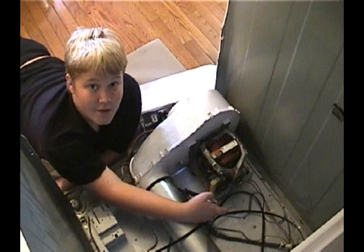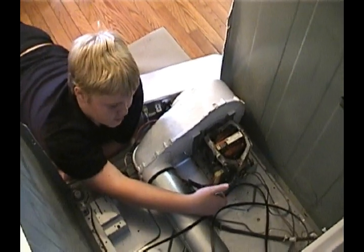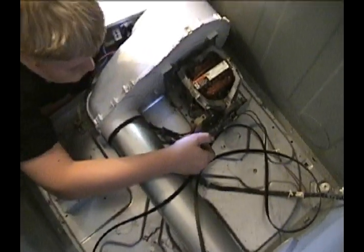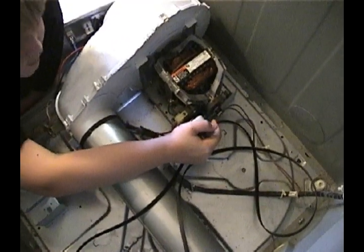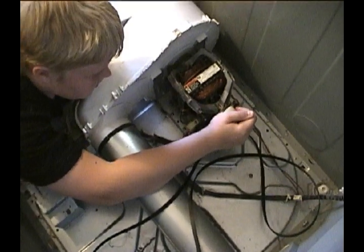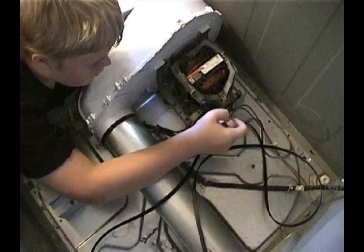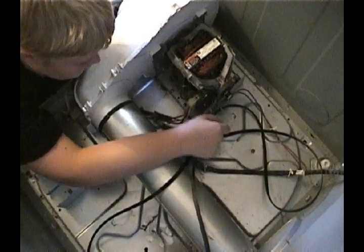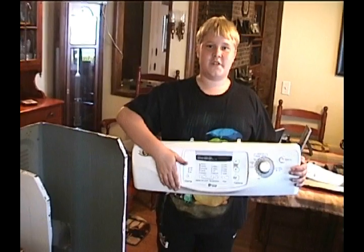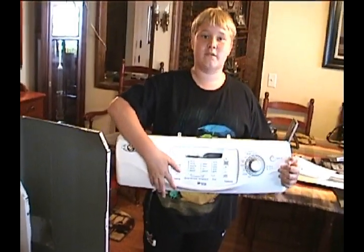Now that I got the drum out, I can better describe how to lift this thing up and remove the belt. Now the belt's not on it right now, but you'll probably understand. You gotta lift this up pretty high, up to here, and then you can just use your thumb and take the belt off when it's still on there. And that is how to disassemble a Maytag Neptune dryer. Thank you for watching.